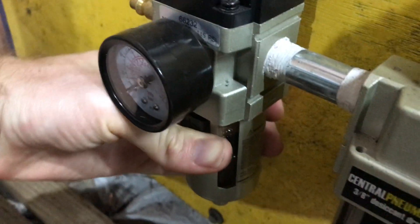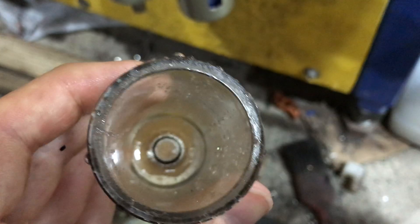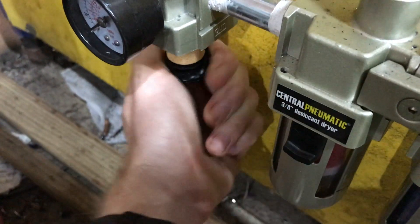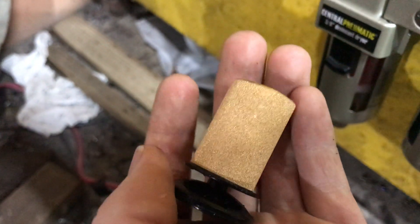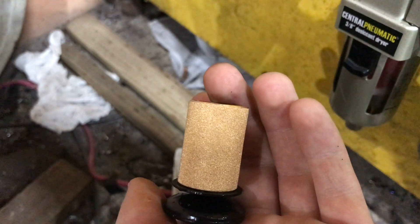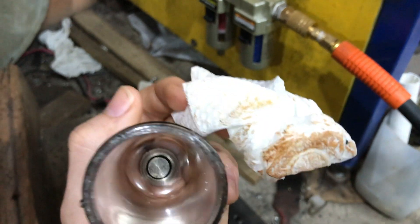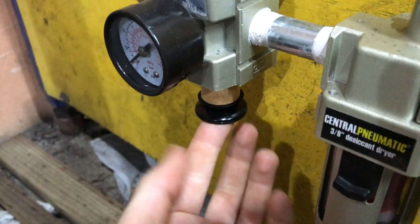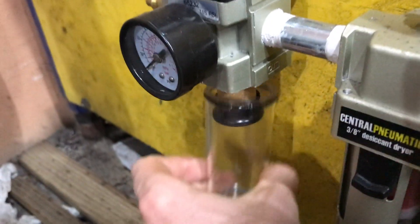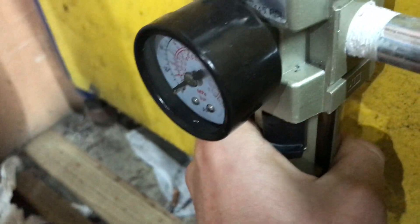After a lot of use the brass filter can get a little oily, so it just comes right off. You can see in the bottom there's a little bit of oil — take a paper towel and wipe that out. This part screws off and you can wash it with Dawn dish soap, which works well to remove any oil that can cause it not to work as well. There's quite a bit of gunk in the bottom. Important: do not wipe the grease off the O-ring — it's petroleum jelly. Once cleaned, give it a twist to click on, slide it back into place, put the retainer on at a 45-degree angle, and it will slide over and click on.